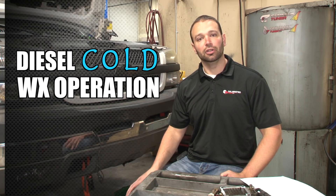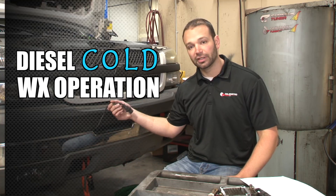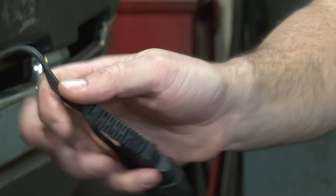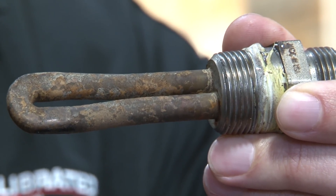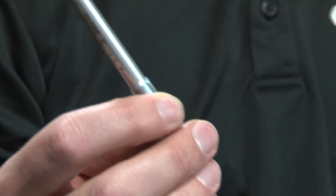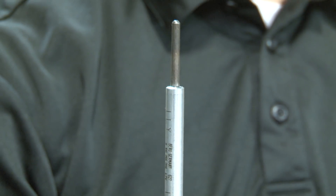Let's talk about other things you need to do if you're running a truck in the cold. The first thing I want to talk about is this plug right here — it's a block heater. On the other end of that plug is one of these. It's a very simple heater that goes into a cooling jacket, so having the truck plugged in and having a little extra heat in the coolant goes a long way. If you don't have a glow plug in a Duramax that's working — at least six or seven of them — that thing's not going to start very well.